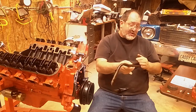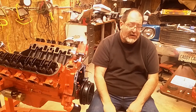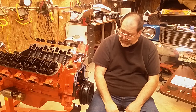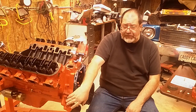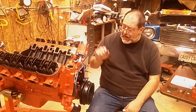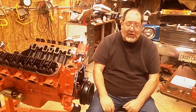Once you get past the pickup tube, you're into the oil pump. There's a whole video on oil pumps - they're all the same size, there is no high-volume pump, but you can port it for a little more volume, which is what the gold pump from Cad Company is. The pump I put on this motor is a G-pump. I bought it used, cleaned it up, and when I pre-lubed it with a drill I got 65 pounds of pressure. Stock pressure is 40 PSI, so they obviously swapped out the spring.